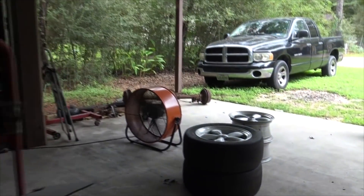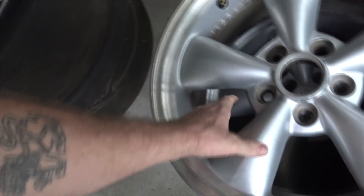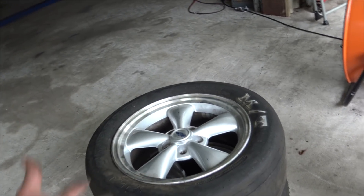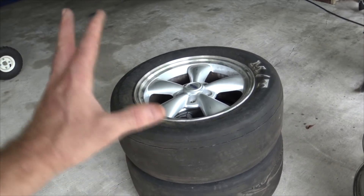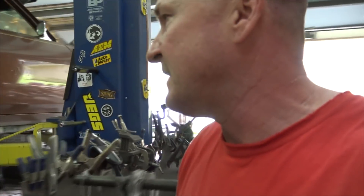What I did do is I got the wheels I knew would actually fit. I went online and there was a guy selling these - one of them is completely biffed from a curb, but they're billet wheels and they have trash slicks on them. These are 26 by 11-and-a-half by 17 - so 26 inches tall, 11-and-a-half inches wide. I can use this to look at tires available for 17-inch wheels. I think if I get a 245/55 or 245/60 it'll fit with a little sidewall - it'd be 8 inches wide, quite a bit narrower. I put it up against the car - it's kind of tight, needs a little more offset.